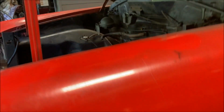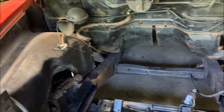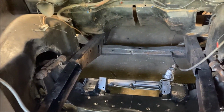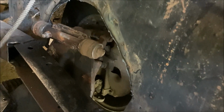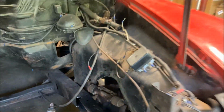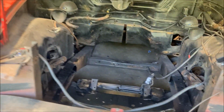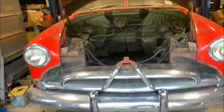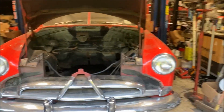So that's acceptable. These Jaguars use plastic shims in the springs, and just taking those out will get a little bit of space. And I don't have the bump stops up very high. You can't see them under there, really. I don't have them way up off of the tower there, so it could go up a little bit more. It could lower some more, but this is acceptable. And if I don't like it, I'll just cut a coil. That's all. It'll be easy.